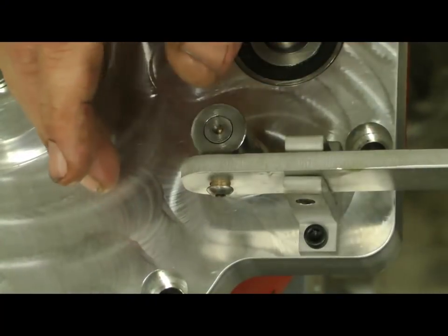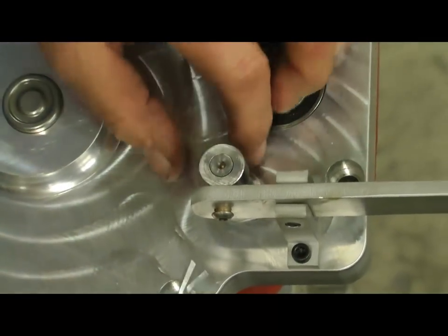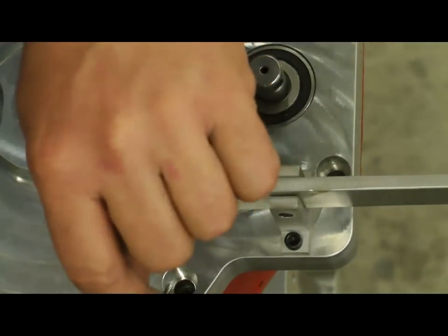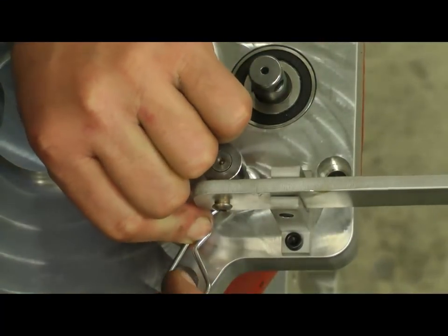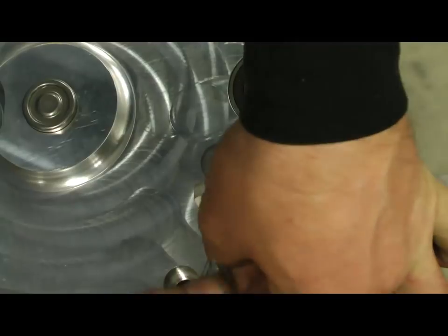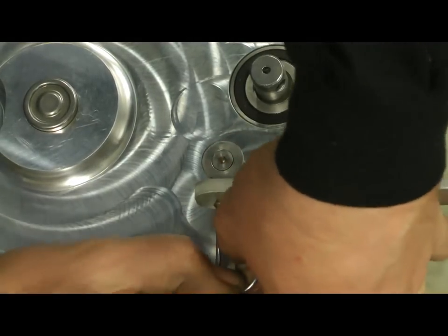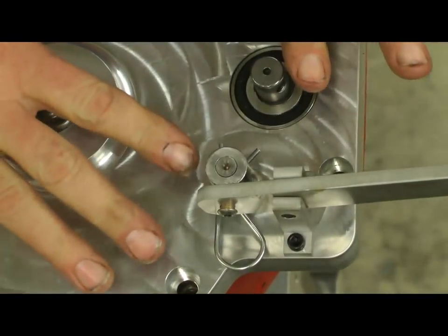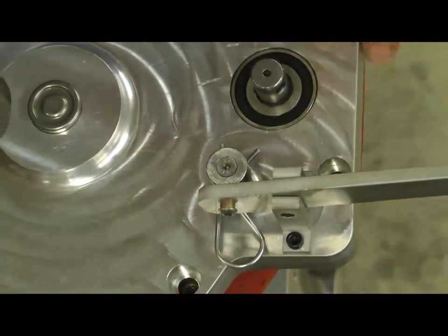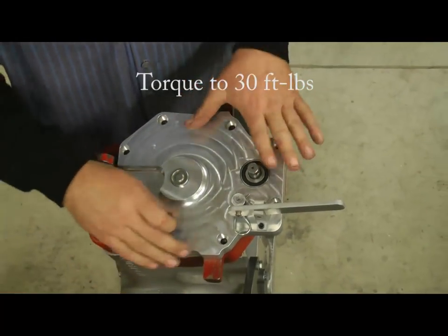You'll need to put your shifter key cap on. It's just a simple hairpin — the deep slot goes with the rippled edge and the straight edge is on the bottom side. You just get it kind of lined up on here and slide it right on just like so. That'll be your detent — you don't need a detent or a shift lock to lock in place. Put your bolts that come with it around here, just tighten it down.